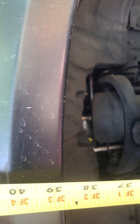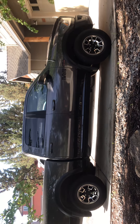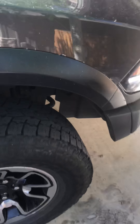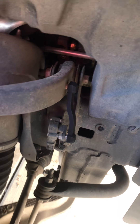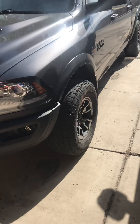You will need a three-quarter inch thin-walled socket to cinch them back down. Don't forget to put it into tire jack mode — go through your settings once the truck turns on, go to apps, scroll over to settings, scroll down to suspension, tire jack mode. That disables your air suspension temporarily. Do your work, turn it back on, take it out of tire jack mode — super easy.